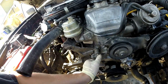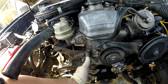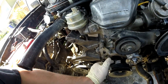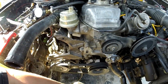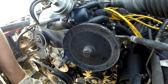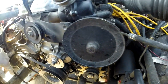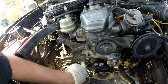I drew something similar to the pump on a piece of cardboard and poked holes in it so I don't lose the bolts or forget which way they go, because this one has about three different sized bolts — a couple that go through the timing cover. You want to make sure you have all the bolts correct. It looks like 10, 12, and 14.